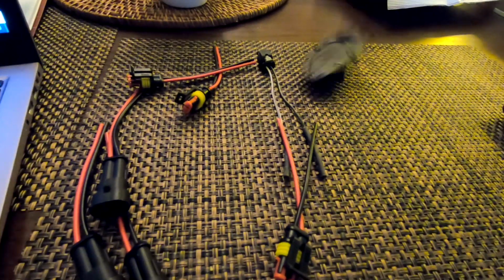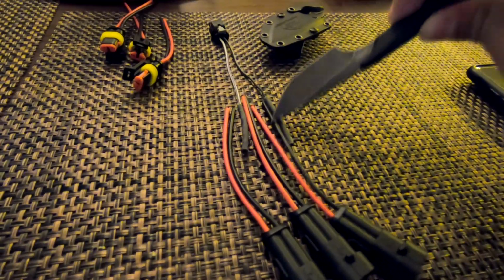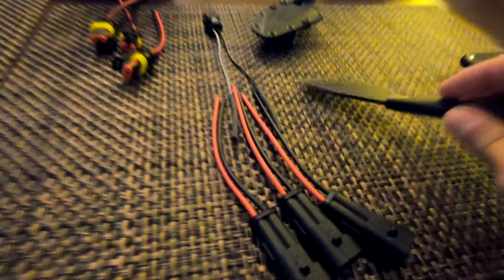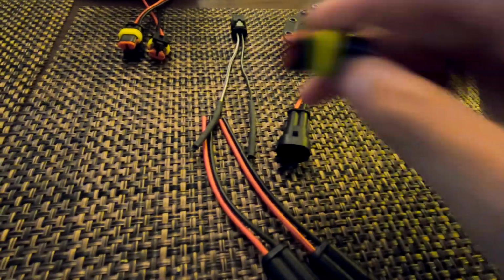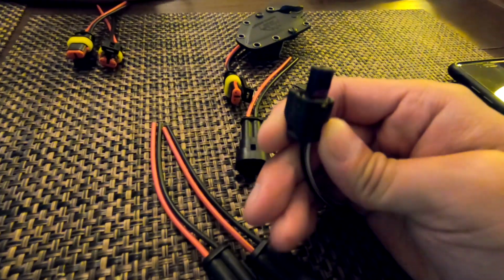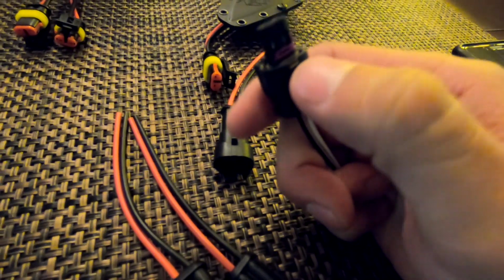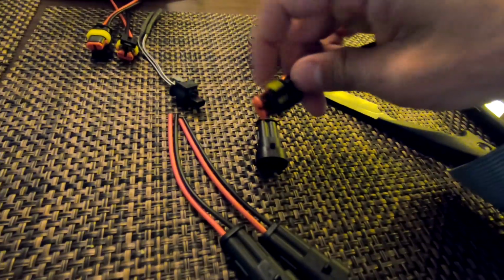So what I'm gonna do is I'm gonna take all the red, well, sorry, the wrong ones. I'm gonna get the plug-in terminals. So I'm gonna just get all the red ones and link them all together and solder it into the white line, and then the black to the black, and kind of create a little wire harness. And these little connectors look like this. It's got a little rubber grommet so that water can't pass through, and it's very similar to essentially this GM socket thing. You can see the rubber down there. Same style, very smaller version, but this is the big version.